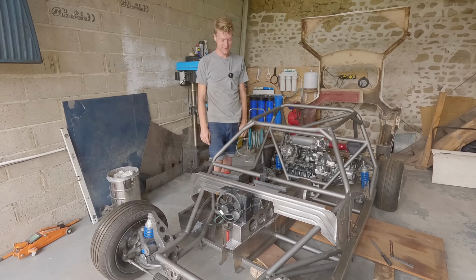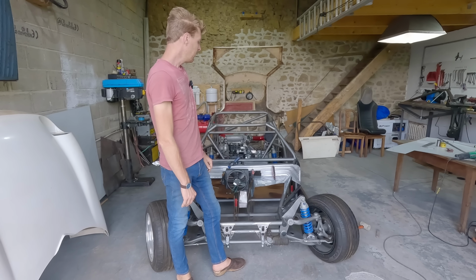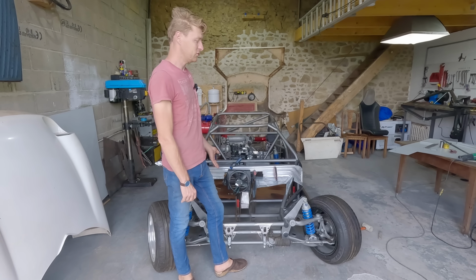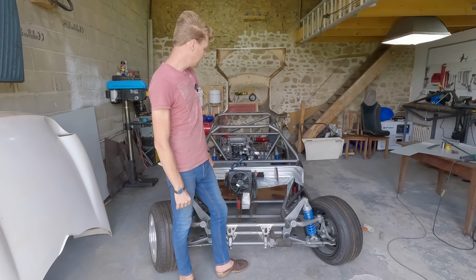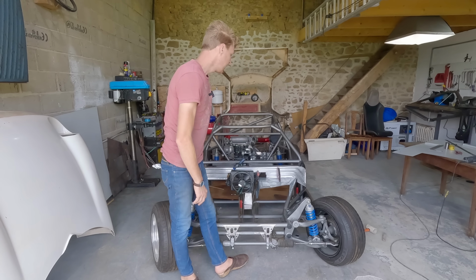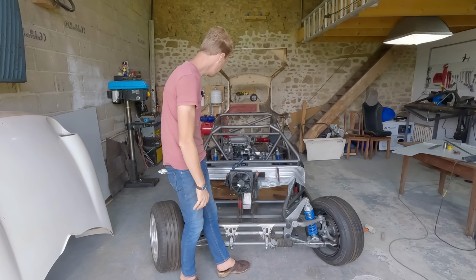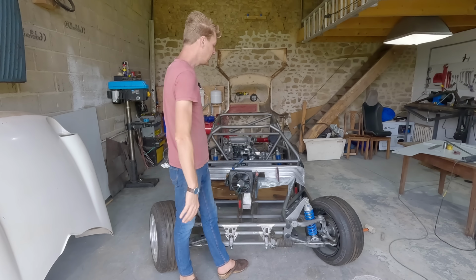One of the issues with moving the heater is that we've made a rod for our own back, because obviously we now need to weld a piece in here and it needs to look like we haven't done anything. But we'll do that next week, because it's not a very interesting job. It's just making a piece that looks like the rest of it, seam welding it all in and then linishing it off. We'll get this done for now. And then when we're welding, we can weld everything all together because we've got all of our parts. And then this can all be one unit that can be taken off and put back on. And it's a whole thing.